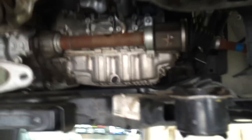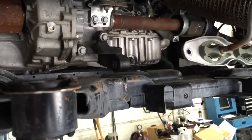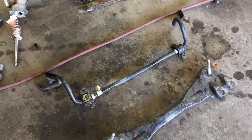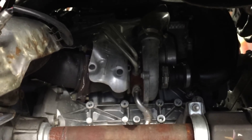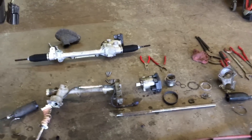You just gotta drop the lower part of the subframe cradle down and take a few things loose. I took the sway bar out just to make it easier to get out - probably wasn't a hundred percent necessary but it just made it so much easier. And there you go - this is a 1.6 EcoBoost, little baby turbo up there, cute little thing - powerful little engine, these things get up and go.